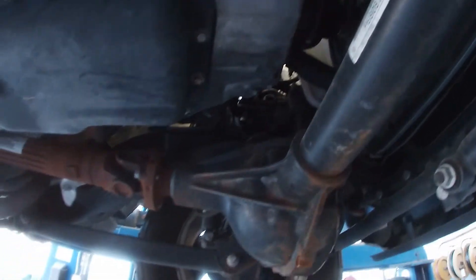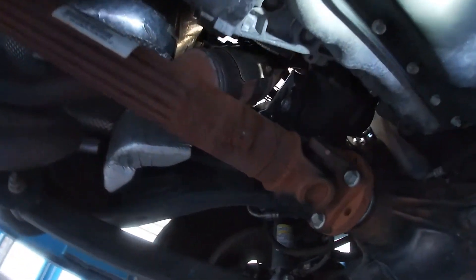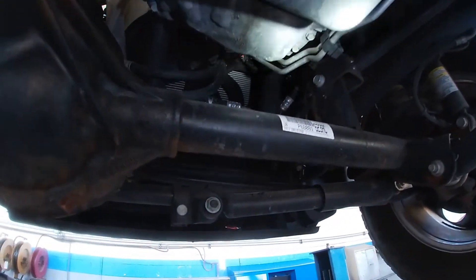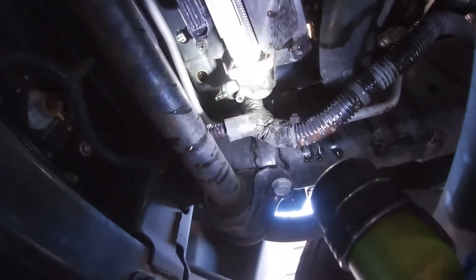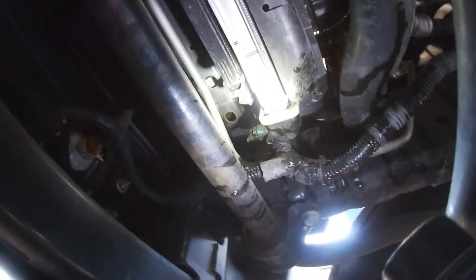With the vehicle up in the air, we can start inspecting for coolant leaks. We're looking at hoses, known problem areas, freeze plugs, core plugs, the engine oil cooler, and upper and lower radiator connections. With the system under pressure, we can see two leaks. The bottom of this tank is crusty, indicating coolant coming down from it. The red coolant tends to dye components, which helps identify leaks. We also have moisture forming at this corner edge where fresh water I added to the system is leaking out.